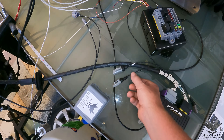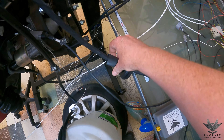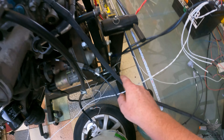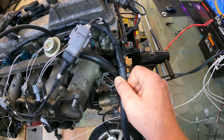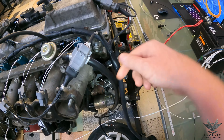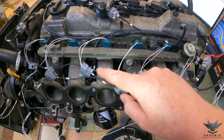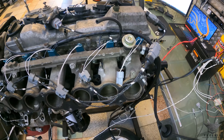These are available to use if he so desires. Coming along from there we've got our grommet - we haven't shrunk it down so the customer is free to reposition it wherever it's most appropriate. Then coming along we've got our first breakout at the back. Obviously this would orient toward the firewall going inside, but coming out of here we've got our injector sub-harness. In this case the customer has the USCAR or EV614 style injector, so those are all along there. We make an adaption for our engine which has the standard injectors, and that's for testing purposes.